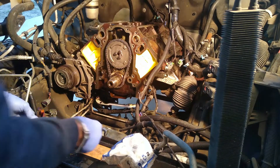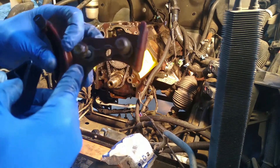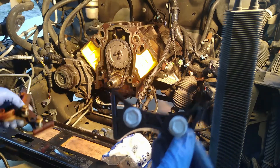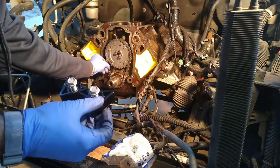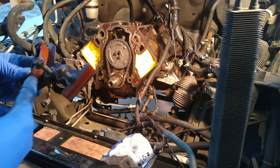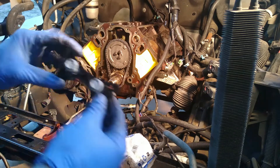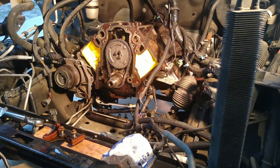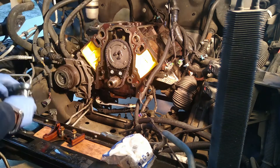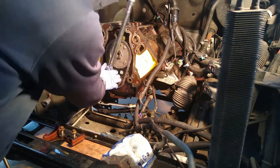One of the things I found real interesting is that the old chain guide had a little tensioner in it, and you had to put that on before putting this on. The new one is just a guide. I heard there can be a little bit of slack in these, but this is not coming off — there's no way. I gotta be honest, I like the idea of having a little tensioner in there, but this is what it calls for — maybe it's better for performance. We got these lubed up — it's a 13 millimeter socket.